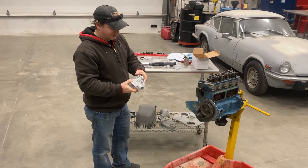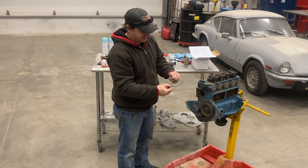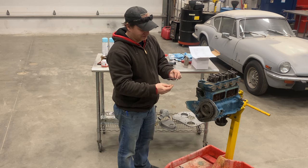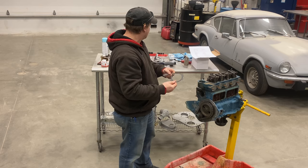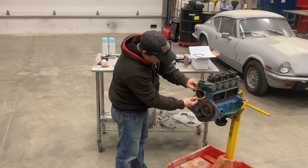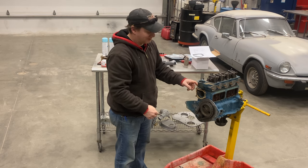I am going to use a brand new water pump. I don't know why it's so hard for companies to make gaskets, but often you're going to find that the holes are not the correct size. A lot of times when they're making gaskets, they're basing them off of old gaskets that have shrunk or swollen up over time. So a lot of times you're going to find that you order a brand new gasket and you're still going to have to modify it. This one doesn't even fit over the locating pins for the water pump. This is the one that actually came with the water pump. I'll open up my gasket set for the engine and see if that one has a better one in it — at least the holes on this one are the right size to go over the pin. That fits a little bit better, still not quite right, but a lot closer than the one that actually came with the water pump.